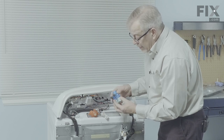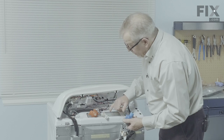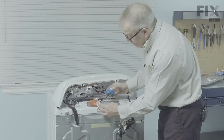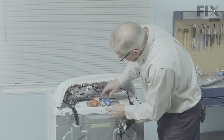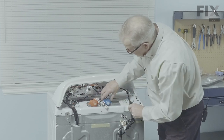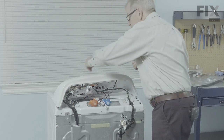We'll take our new valve. You may wish to just wet those two grommets so that they'll fit easily into the two openings. Then we'll just line them up, press it firmly into place, and make sure that both of the mounting tabs sit firmly on those posts. We'll reinstall the two screws.